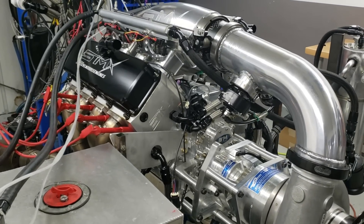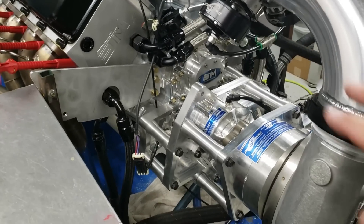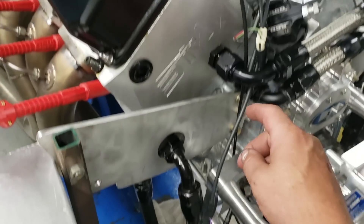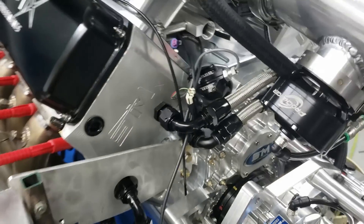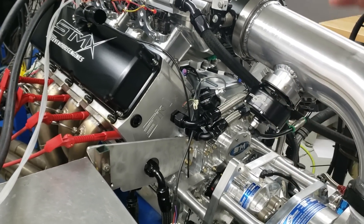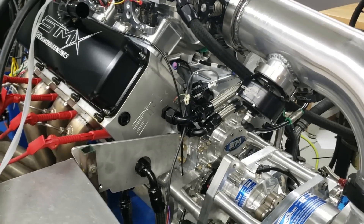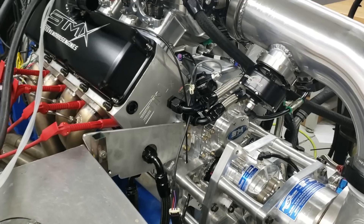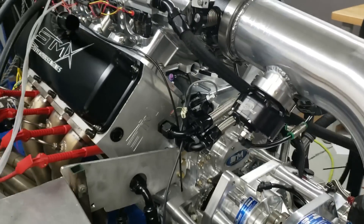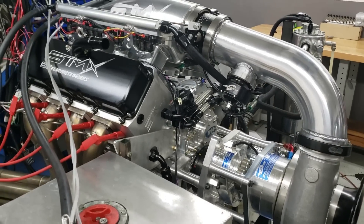This is a 540 cubic inch SMX, fully water jacketed. You can see water in, water in, water out, water out — each side. Fully separated: there's no water that goes between the cylinder head and the block. Each compartment is fully separated, each cylinder head has its own water system, and each side of the block has its own water system. Nothing gets transferred between top and bottom, nothing between side to side. Technically it's four lines in, four lines out.